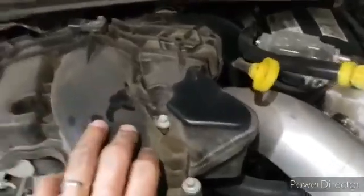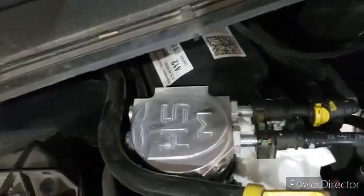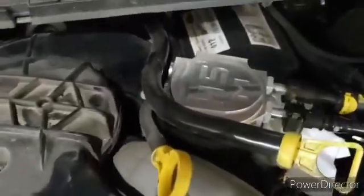To get the upper intake manifold — this black piece here — off, you need access to the side where the bolts are. I have an aftermarket fuel filter head, but it'll be the same process for the factory one. Disconnect these two lines and pull the filter out of the way for better access. You can see there's a bolt that holds the two dipsticks together and mounted — those will be in the way of the bolt underneath the dipstick tube.